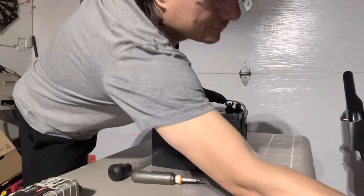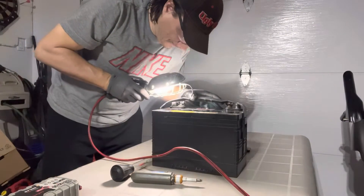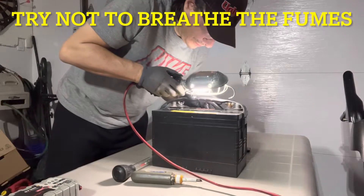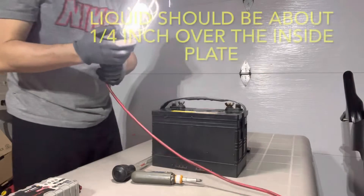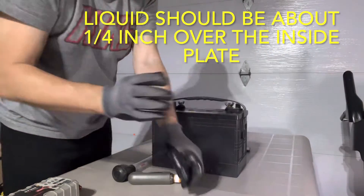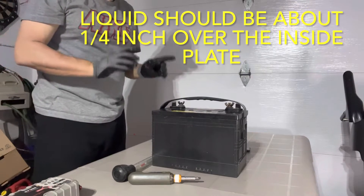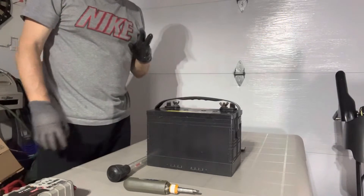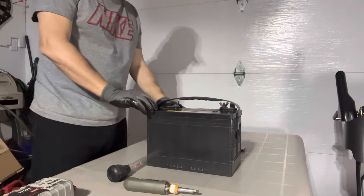Take a light inside your cells. My levels are fine. If you see you're missing any liquid, you need to add distilled water — don't put tap water, distilled water only. That's step two.